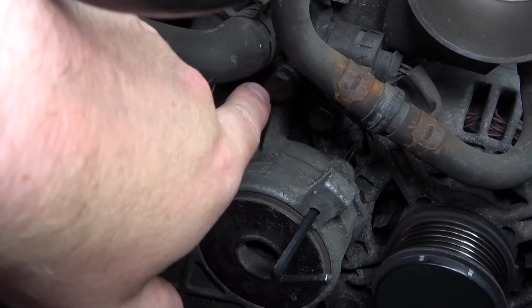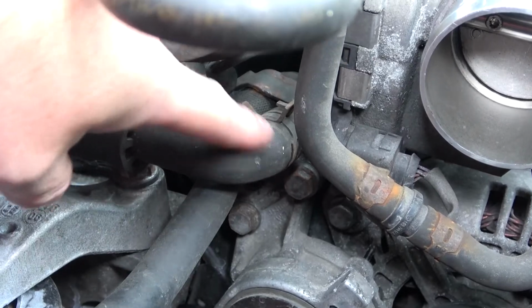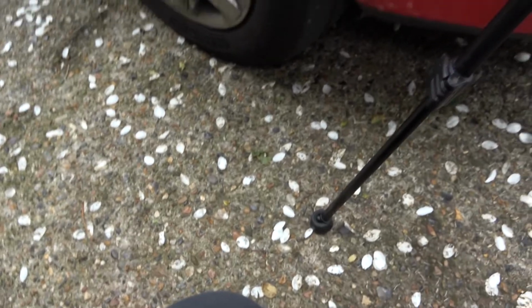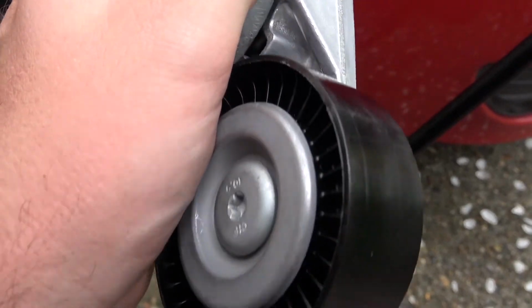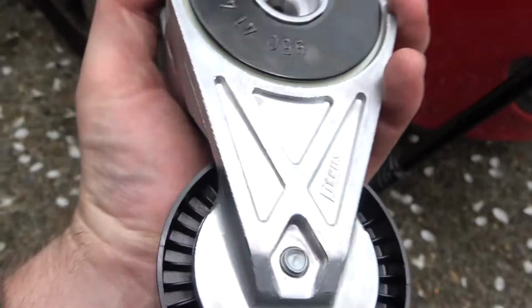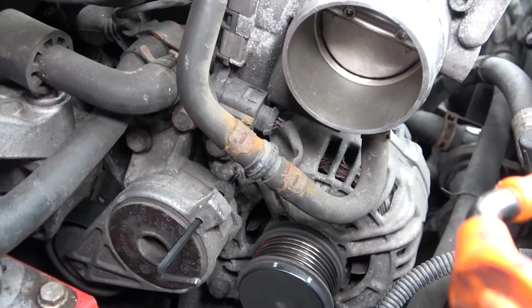But there's a very important thing to remember with this little bit here, and I'll show you once it's off. It's like a little metal plate that holds these coolant pipes together. If that is the wrong side, this pulley down here itself, a little one there, because as you're looking at it like that, this here will crash into the engine cover and it will ruin this nylon-like spinner or pulley. So you don't want that to happen. So you have to be very careful about where that plate goes, where the rotation goes, and where it sits.